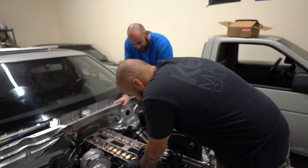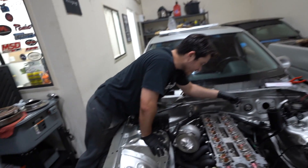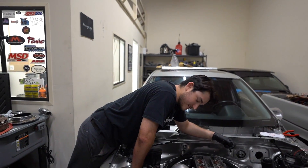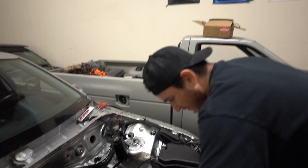Junior's holding the head and we're starting to put the head studs in. What should we have done before this? Put the washers on first. Do your research — you cannot put the washers on after the studs. We had to literally lift the head up again while the washers went in. Three guys — actually four guys — lifted a 1JZ head. Nick did most of the work. Our first studded motor that we did ourselves.